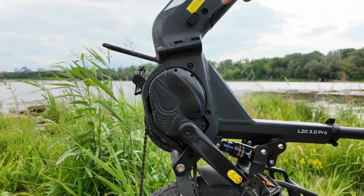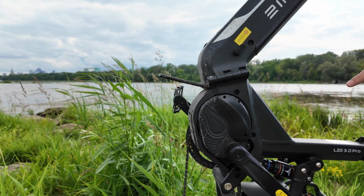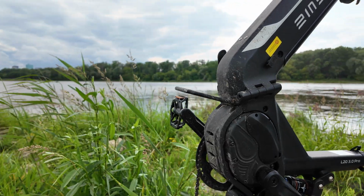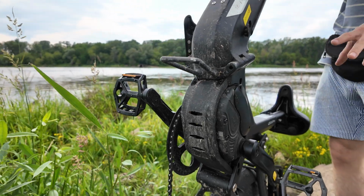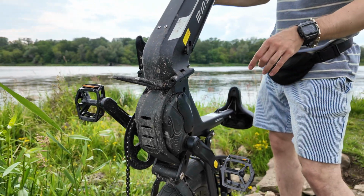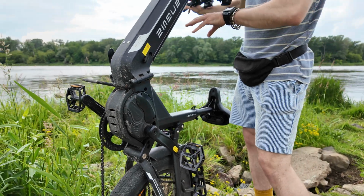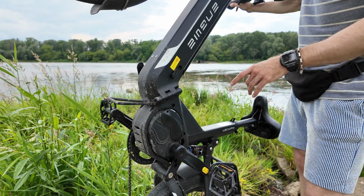You can also use, as said, the torque in all of the gears on the bike. However, it does come with a few caveats, a little more maintenance, and the chain can wear off more quickly. You need to be careful with shifting on the bike because it doesn't stop accelerating if you shift, and this is the biggest chance of damaging either the chain or the cassette.